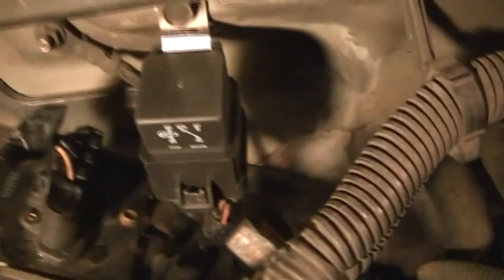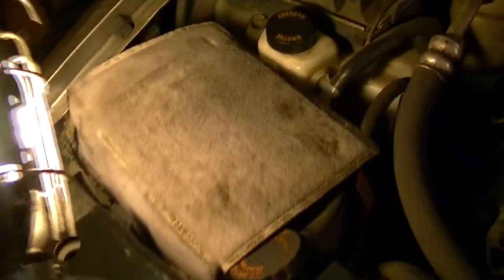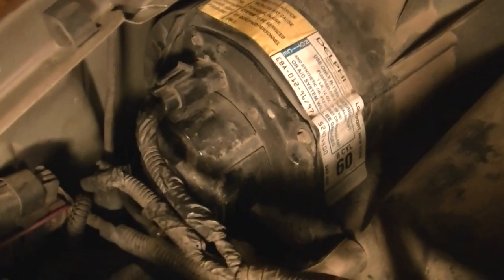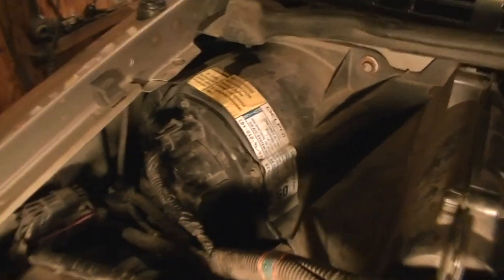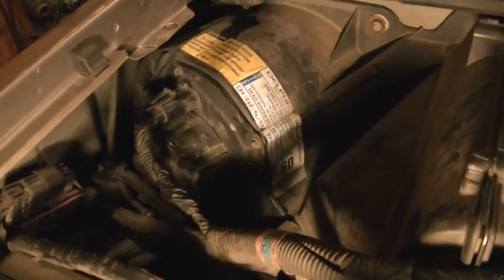So there you go, thanks for watching — hopefully this will help you out. More than likely that relay is going to be under your dash, but on a lot of these S10s it's right there on the firewall — something that people overlook all the time. There's a main hot wire that goes from the battery straight to that relay and feeds power constantly to the blower. It's kind of a design flaw, but the part's back on and we shouldn't have any more problems with the blower, although we will have to change that blower motor later because it's squeaking and running on high all the time has pretty much destroyed it.